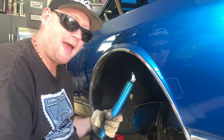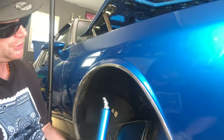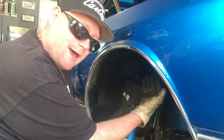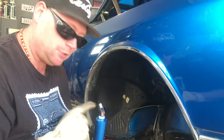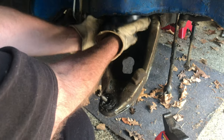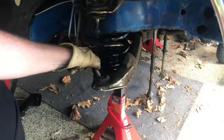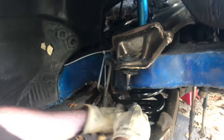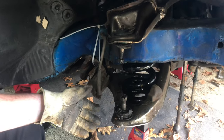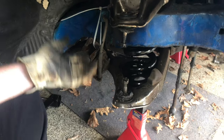So we're here on the passenger side of the Caprice. I have the cylinder ready to go and also the spring ready to go. We are going to gently install the cylinder up into the spring pocket, and I'm going to be very careful not to nick or damage the fitting as we go up in there. The cylinder we're just going to push up into that hole, and now we're going to get the spring in place. The cylinder and the spring are in — this side is ready. I'm going to have to put the spindle back with this just supported by the jack stand down below, but we have the cylinder in, we have the spring in, and it looks pretty good.